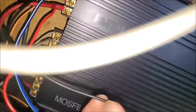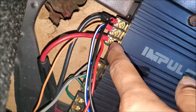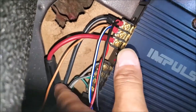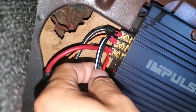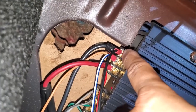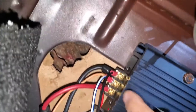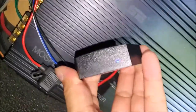It has a hot wire with a fuse, a remote wire which is the blue that connects to the remote on the amp, and a black ground wire. I unscrewed the hot wire from the amp, then the remote, hooked the blue to it, and connected the ground wire from the receiver to the ground. It came on right away and started blinking.